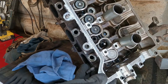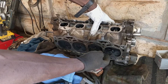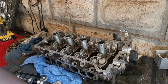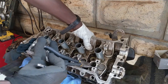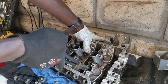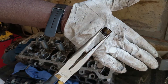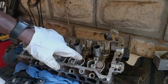Remove the other lock, keep it to the side, the spring comes off, and voila — there we have our released valve. You can just push it down and remove it from the head. No judgments please — we didn't clean this up before. At this point we take our long nose pliers, go in there, and basically yank the old seal out. I haven't found a way of removing these without damaging them completely, so I usually just yank them out and deal with the fallout from there.